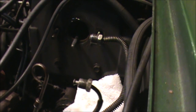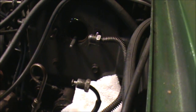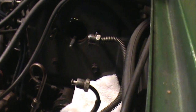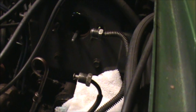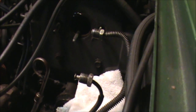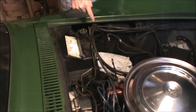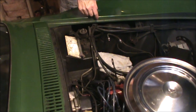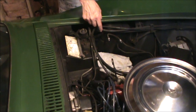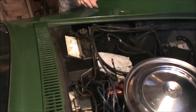What we need for this job is quite simple — just a 9/16 inch wrench, typically the only size wrench you need for a Chevrolet. One thing to mention: always when working with brake fluid, make sure you are using rags to catch any overflow. There will definitely be overflow when we take the temporary plugs off to install the brake lines.